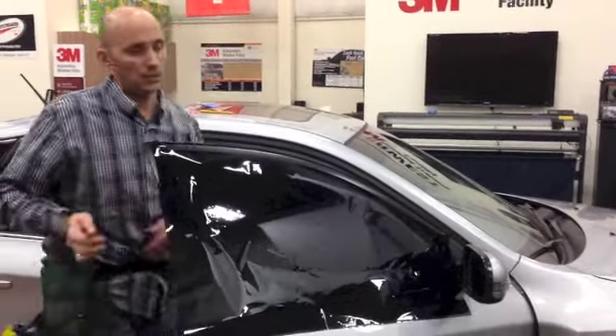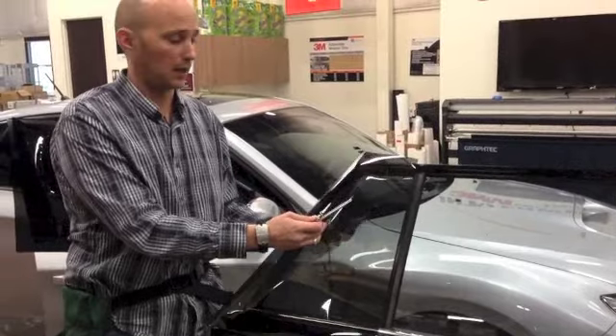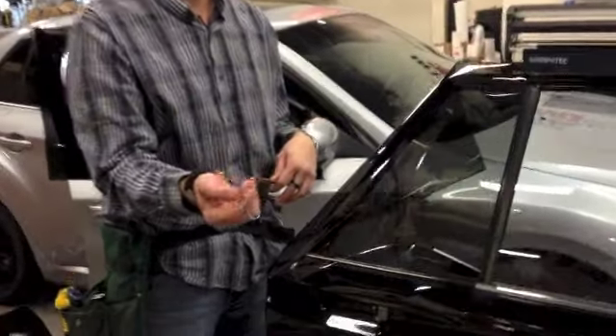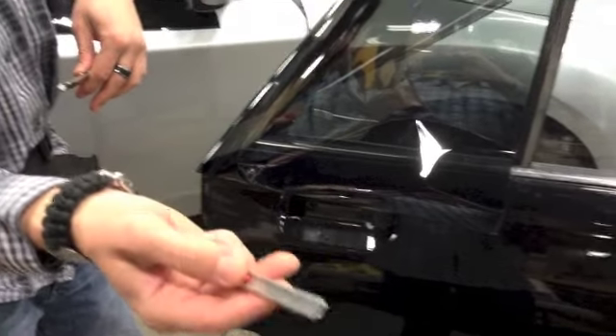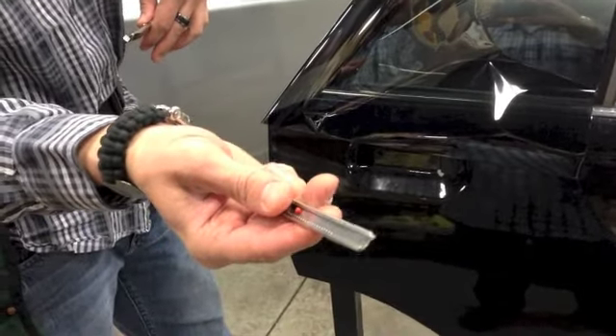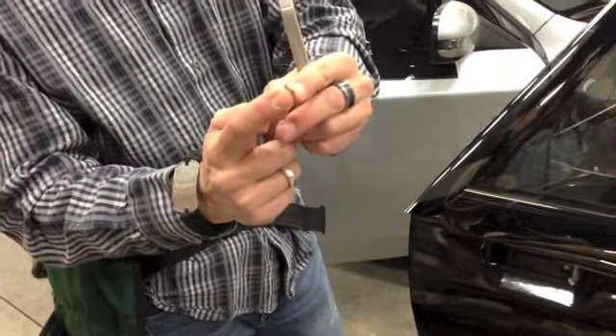When I come to actually cutting side wing windows, some of the wing windows that are the most difficult have even rubber seals on the inside and out. To do those, generally I like using an NT Red Dot because they have a finer adjustment on the actual blade track. If I go out just the first click out, what it allows me to do is actually ride the rubber next to the seal against the actual blade holder, like so.